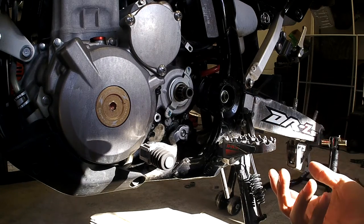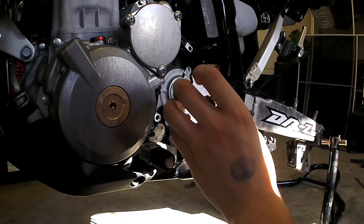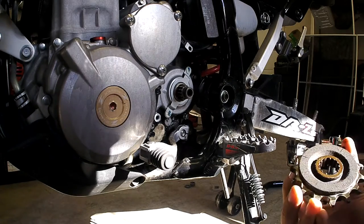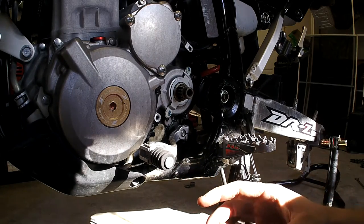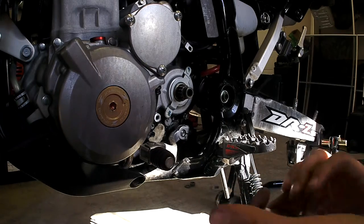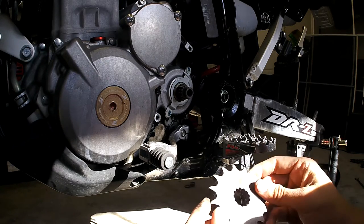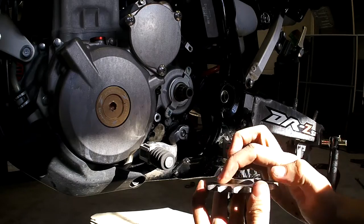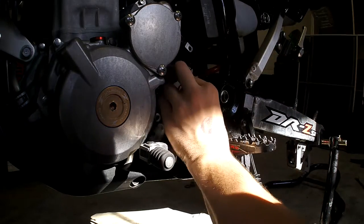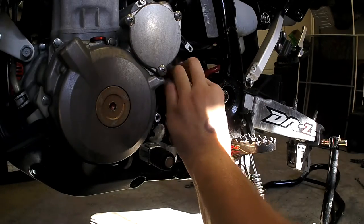Since I'm here, before I work on the rear sprocket, I'm just going to go ahead and throw the front one back on. This old sprocket was a more expensive one — it's got a nice rubber bushing around here that the chain rides on. If you get one of the cheaper sprockets, most of the time they won't have the rubber bushing. Just make sure when you put the sprocket on that you have this lip going toward the bike, because if you don't, it'll hit the chain guide and won't spin. Always put the lip to the back.